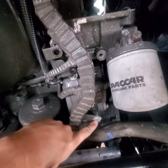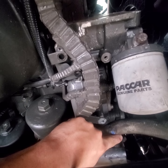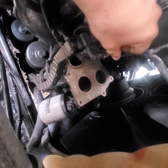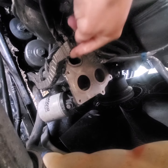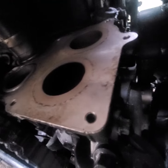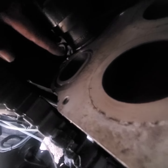There's a bolt down here that holds a piece of steel that holds your radiator hose up — get those out the way. When it comes to the actual cooler, the thermostat housing, there's a bolt back there, there's a stud bolt there, and there's a total of six fasteners. You got one, two, three, four, five — I'm missing one. There's another one back here you can't see.